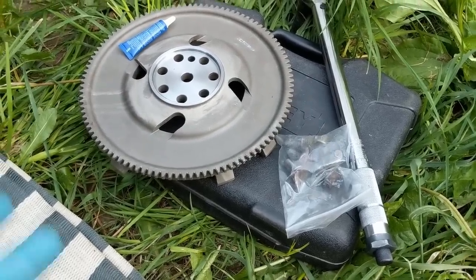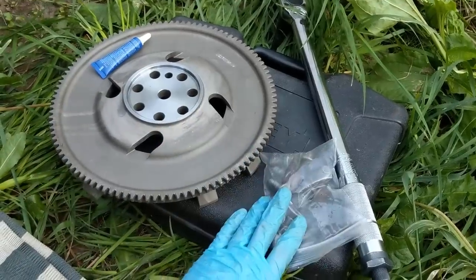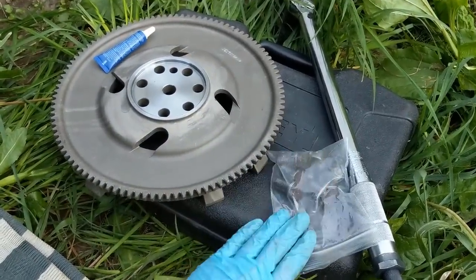So you can check out some of my old Eclipse videos if you wanna see that terrible excuse for mechanic work. So I'm just gonna get to torquing these down, and I'm probably gonna do it in steps of 50, 75, and then 100.